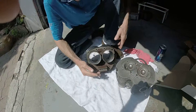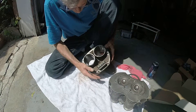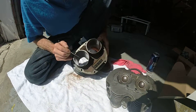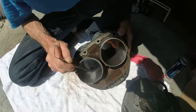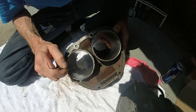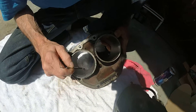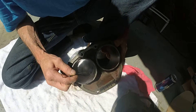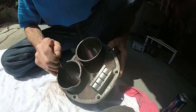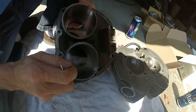This is the BSA engine here and I brought it to me and I was looking at it. If you look inside the cylinder real close you can see these lines that go around it, and you can see all these little marks — they're like hollow spots there. That's where the piston rings were sitting when it was stored over the years with moisture. You can actually see the shape of the piston ring making rusty marks along the wall.